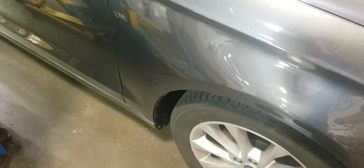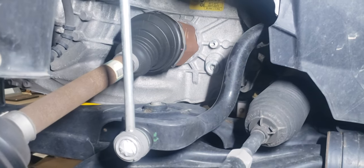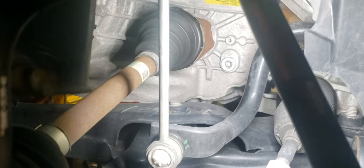I'll mention that a couple of these 2017 Fusions have problems with hard shifting. This seems to fix it — when I first bought the vehicle it was shifting hard from first to second, but after doing this transmission fluid change, it seems like it's shifting fine now.